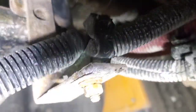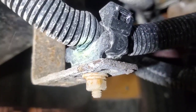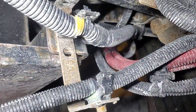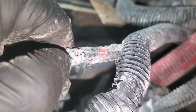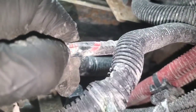I think we found our problem. Situate the light here — that, as we know, is bad. Good for us because we found it pretty quick. We're going to cut that zip tie and open up that loom and see what we've got. Oh yeah — there we go. Look at that. There's our culprit. This wire here runs up to that DEF pump relay, and that is why we are losing all our voltage — this corrosion is creating a resistor in the circuit that's taking up all those volts.